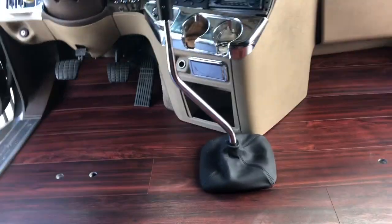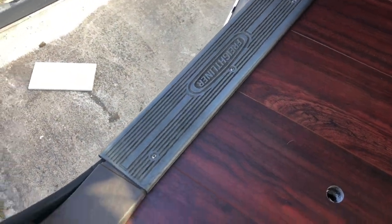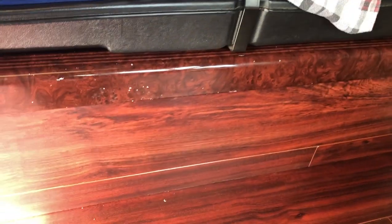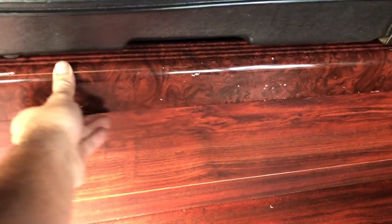Here's the final product - I hope you guys like it. This is how we finished it. You can see it looks nice and clean all the way around, everything fitted pretty good. Right here there was a little grommet or washer underneath the plastic - we had to shave it off. But everything else fit as it should, and we ended up putting floor here on this part too. It was really easy - all you have to do is cut the carpet on the bottom with a knife, score it and pull it out, and the vinyl floor will fit perfect.